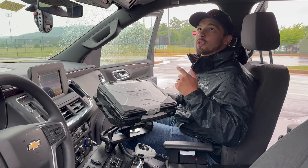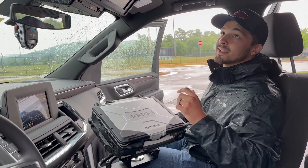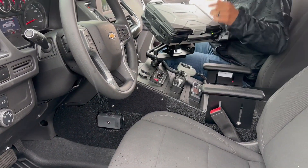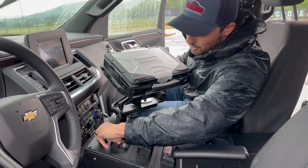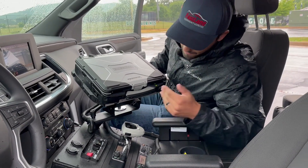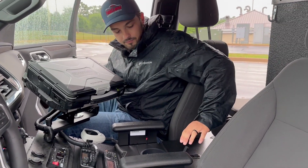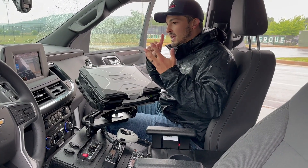So we're talking in the cab — always going to start with the overhead. Cab design, CNC cut aluminum faceplates, powder coated — the whole nine yards, all custom here at Fastlane. White map light, red map light, 7-inch FastFlex touch screen that controls all the functionality of the vehicle, OEM airbag module, and radio speakers. Moving down, as always, the 820 bus fuse block — every aftermarket fuse in the vehicle is run through there, so it makes for really easy troubleshooting. SL295 siren controller, couple of power points. One 12-volt cigarette lighter, one dual USB. There will be customer-supplied Motorola radios and magnetic mics. They have their Gamber Johnson tablet holders with their Havis dock and the customer-supplied Toughbook. Armrests, cup holders, big storage area. On the other side, they have their OEM USB, USB-C, and 12-volt cigarette lighter.